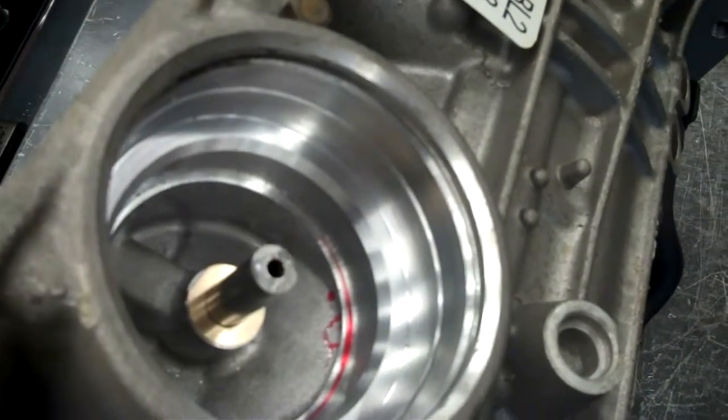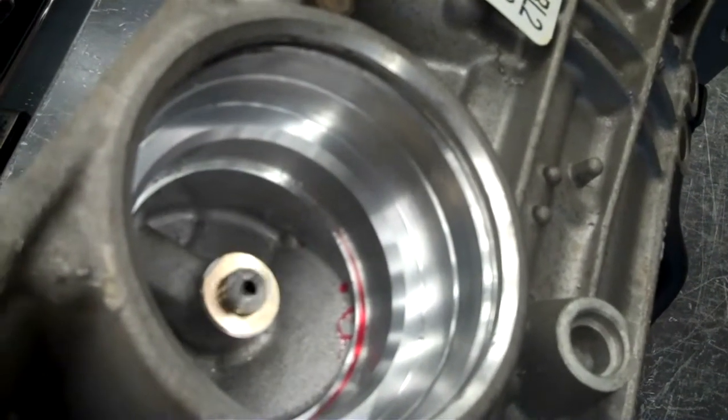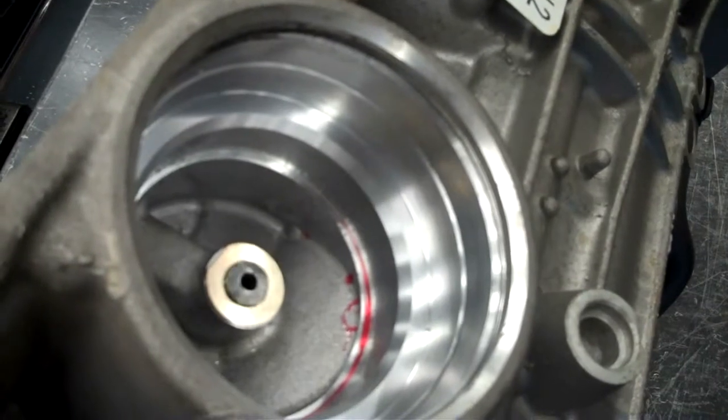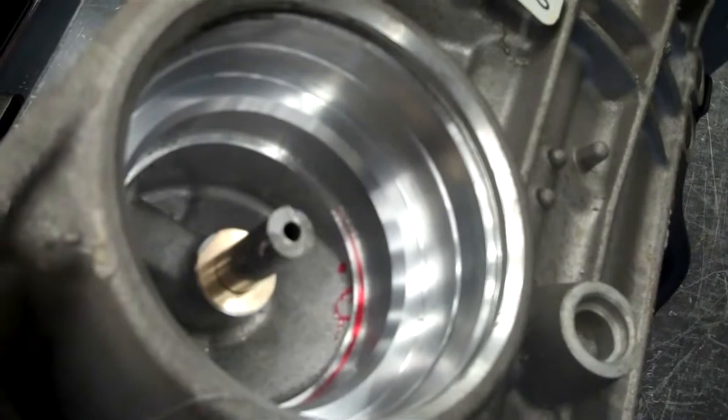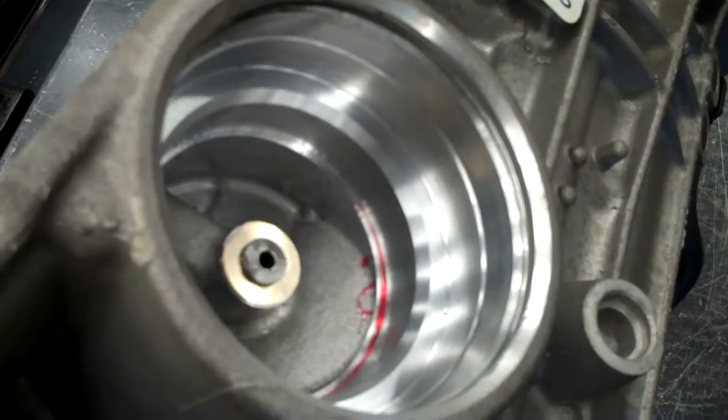Always put the taper to the contour of the case. What we're showing here is how easy the pin glides through the hole now that the holes are already cut in the side of the bushing, so you're not having to drill and it burrs the hole up, causes the pin to stick.